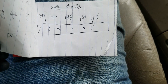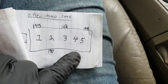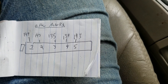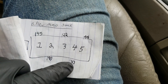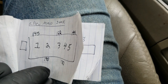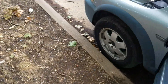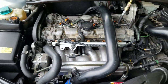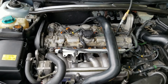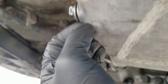Cylinder four went from 122 originally to 130, so we definitely raised our numbers all the way across the board. Even off the Marvel Mystery Oil numbers we still gained some — nine PSI on cylinder four, 130 to 139. We stayed about the same on cylinder five and cylinder one, but the others in between got a pretty big gain. Cleaning up did help. We most likely have worn piston rings or worn cylinder walls rather than stuck rings, so the next thing we're going to try is the RESTORE product.